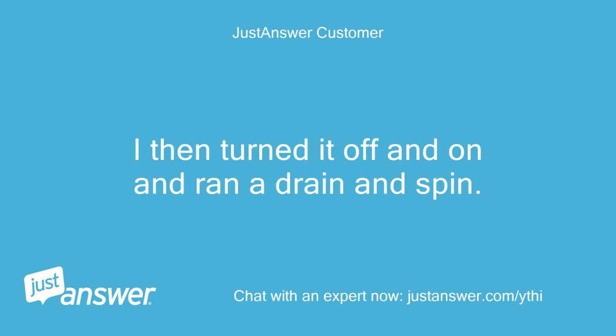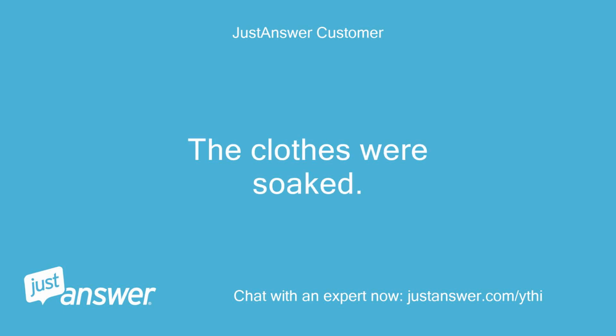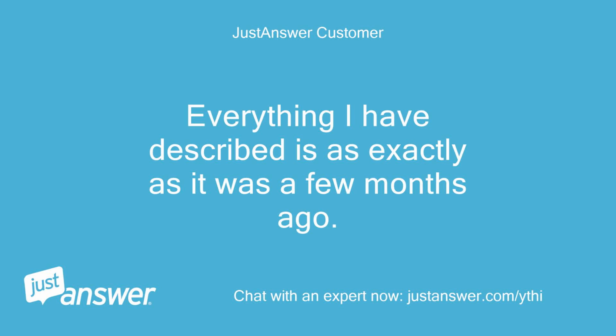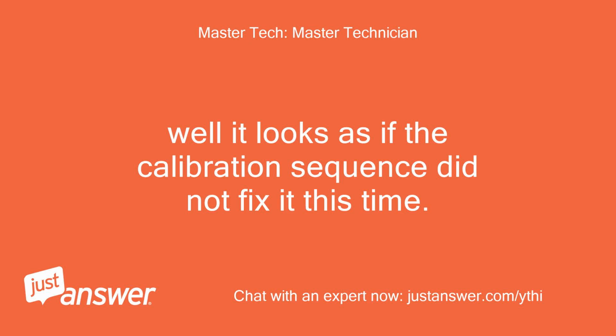I then turned it off and on and ran a drain and spin. It drained the water, but never spun. The clothes were soaked. Everything I have described is exactly as it was a few months ago. A reset was all it took to fix the spin cycle. Well, it looks as if the calibration sequence did not fix it this time.